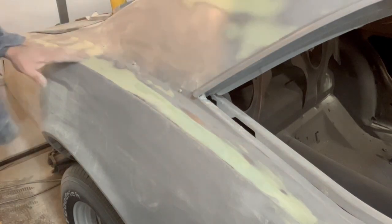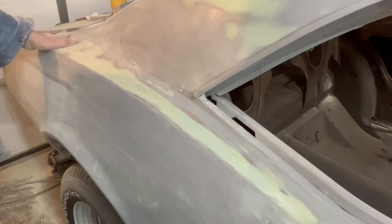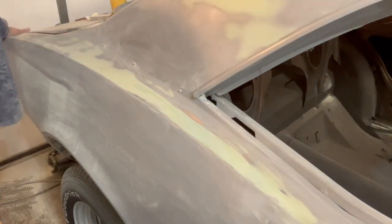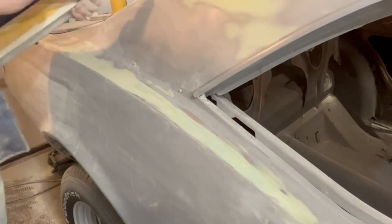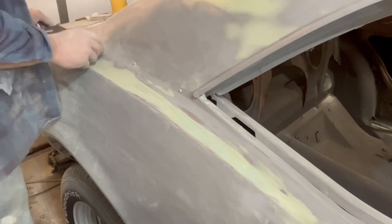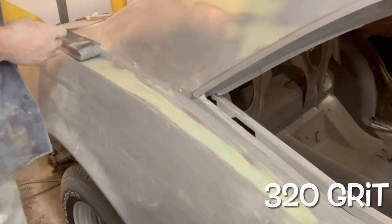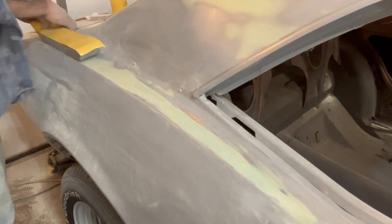Now that was just finished with the 180. I think we'll hit it with 320 and make sure I don't have any weird spots in it. And if it all looks good, I think we'll be done. So, see you later, 180. And so we're going out with the 320. Let's do the same thing here. It's actually cutting out pretty decent.